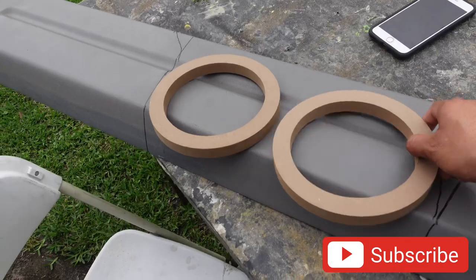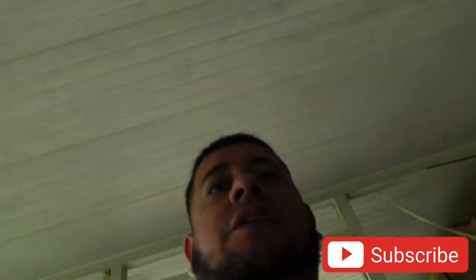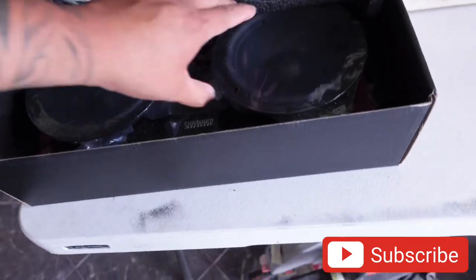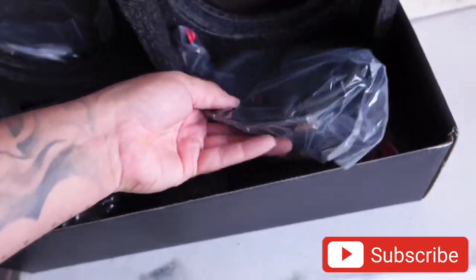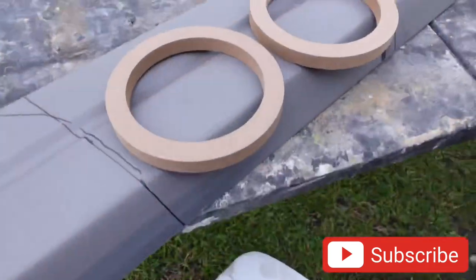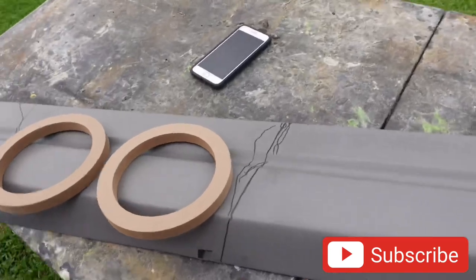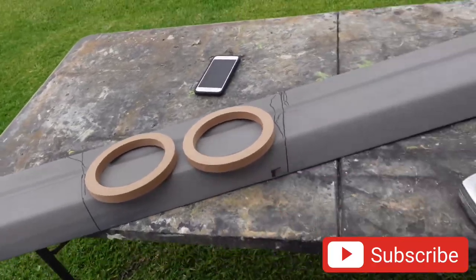Now I know to stay inside this border right here. We'll do a six here, a six here, and maybe a tweeter right there and a tweeter right there, and it is done. We're going to pop this out just a hair so the speakers can sit in there. The speakers are not even that deep so it doesn't require that much crazy stuff. We're still going to put a good amount of strength on those rings so they don't collapse while we're fiberglassing. We're doing the Sundowns, and these are just a component system - they're like shallow, probably only like two inches deep, so we should be good. Since we're doing fiberglass, we got our router out and put that lip in it so we can staple through it and get nice sharp edges whenever we glass it, giving us nice curves when we start doing bondo and wrap it.